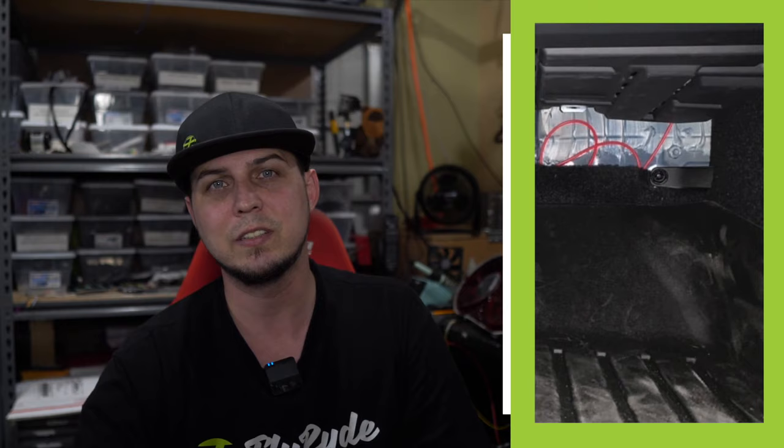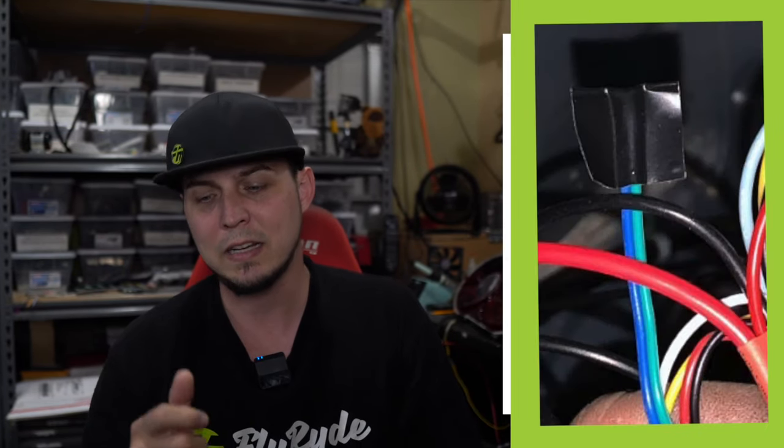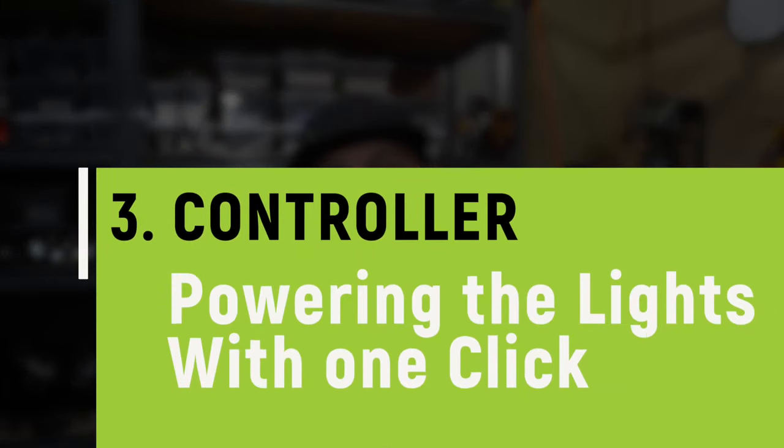My customer who installed the taillights from this video had to run one wire all the way up the panel, through the door sill, up the firewall, and right behind a grommet conveniently placed behind the battery. Since he just got taillights, we didn't even have to mount the controller near the battery — it lives right behind the taillight. I talked to him today and mentioned he's got two extra inputs: button C and button D on his remote control. If he ever wants to add cool color-changing interior lights, he can easily connect to one of those wires and everything else is already done — he's got an easy way to power anything on the interior of the car now because of that controller.